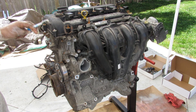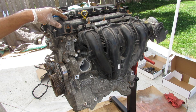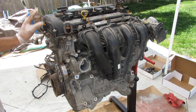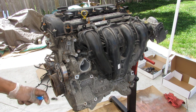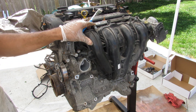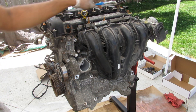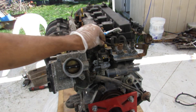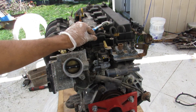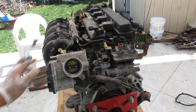Taking a quick look around this engine, this is a double overhead cam engine underneath this plastic valve cover. The intake side has variable valve timing. You can see we've got this timing cover here made of metal, and this would be your water pump. At the front there's a plastic intake manifold which has variable geometry to help with air intake flow, and port injection up at the top. Around the back of the engine there's a lot of hosing and wiring for the cooling and vacuum control systems, as well as the EGR valve and throttle body.